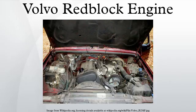G — LH2.4 Jetronic but without CAT converter, CO adjustment on the airflow meter. Some models without O2 sensor, others with O2 sensor which requires regular replacement at intervals due to lead fouling, for markets where unleaded fuel was rare in the early nineties, such as Eastern Europe. FB — low compression version of B230F with the 531 cylinder head and BX3 camshaft, with power outputs 11 kW less than the B230F.